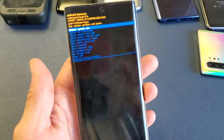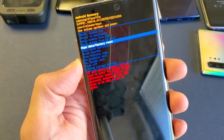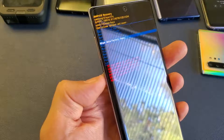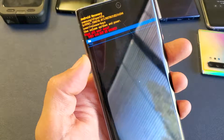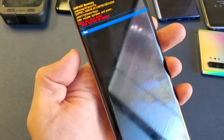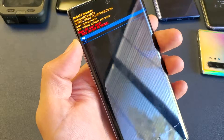I did it on my first try, and from here you guys can just go down to wipe data slash factory reset. To select it, press the power button, and then it's asking you to confirm. Use the volume rockers to go up and down. If you want to proceed, go to yes and then tap the power button. I'm not going to factory reset this, so I'm going to go back to no.